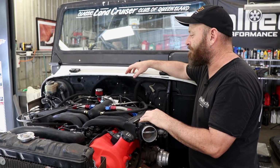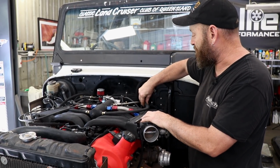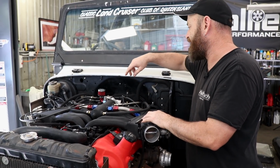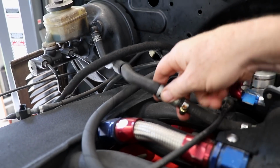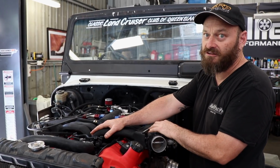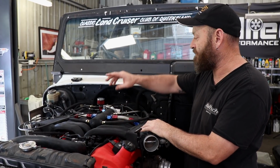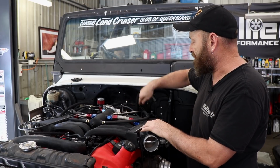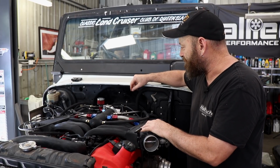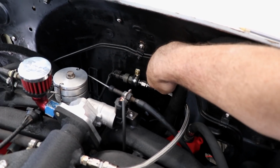We've got the rocket ship all bolted up and I've plumbed it up as well. So the plumbing consists of, out of each valve cover, we've got the PCV into it. So that's basically just pulling through and back into the engine. We've got the brake booster over there. Used to have a line for the fuel pressure regulator, but we're actually going to use an undercar, just a static reg, so we don't need that anymore. And this one here with the braided line on it is actually the map sensor. It's a TI map sensor, so it's something ridiculous like 5 bar. But they don't like being screwed into engines, so it's remotely mounted hanging off the firewall, off a P-clip.